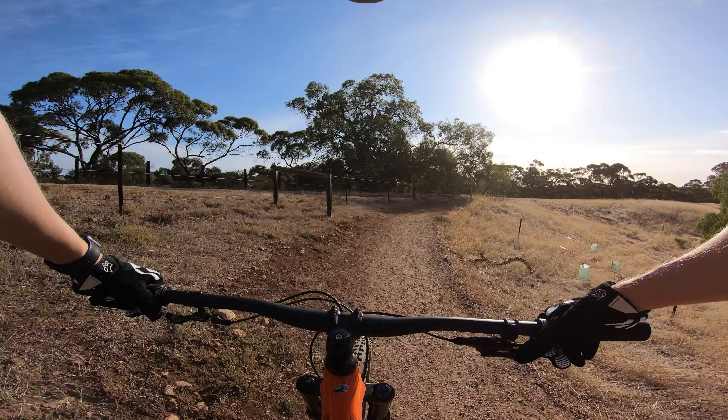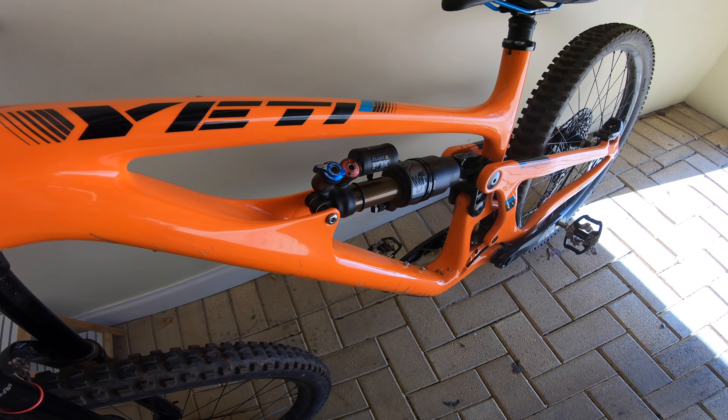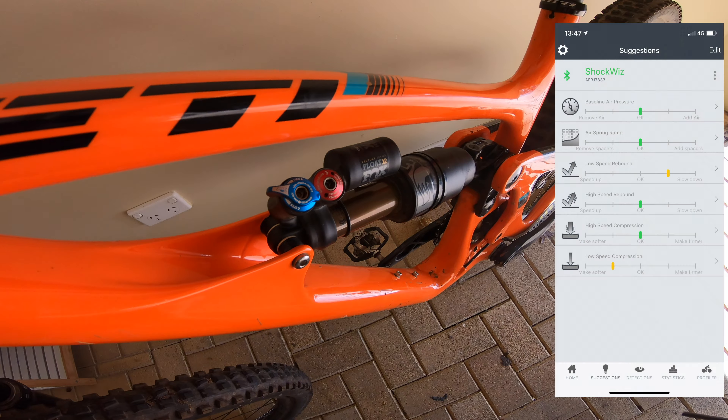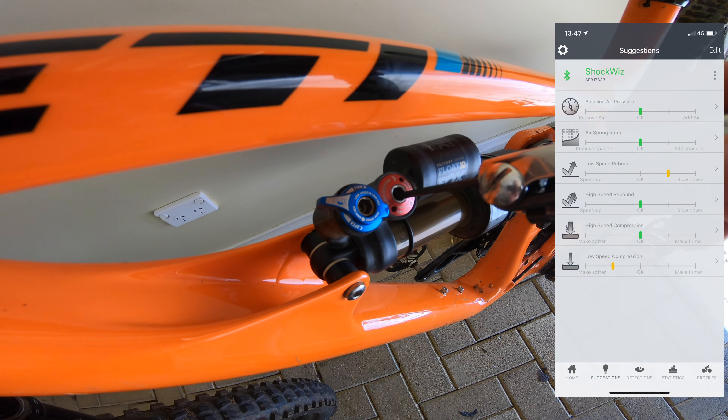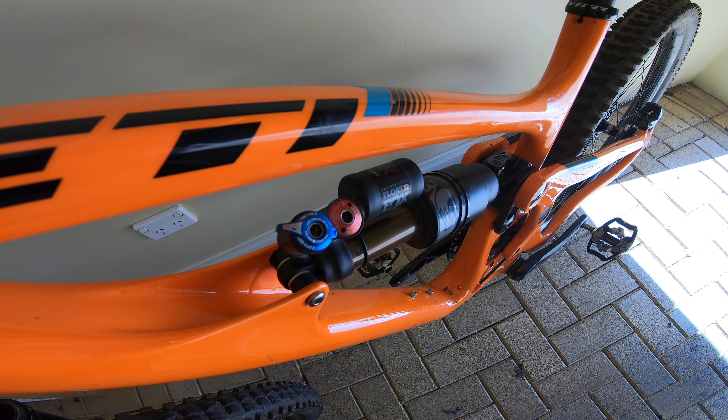I'm 10k's into a ride at Eagle Park, and as you can see here, compared to Cobblers, it wants a lot of changes — more air, more change. So you've got to tune to where you ride. All about those deep compressions. Wanting more air. After a couple of rides, it wanted less rebound, more air pressure, and now after this most recent ride, it wants a little bit slower rebound. So here we go — 3mm Allen key in, one to two clicks — one click. All done. Let's go take it for a ride. I reckon we're pretty close.